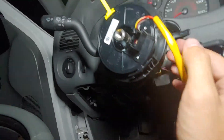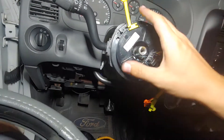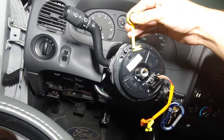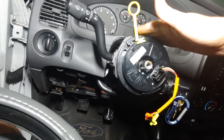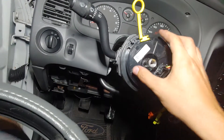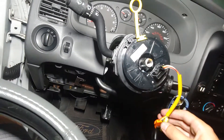Make sure everything is routed properly and that the wheels are straight before you mount the steering wheel. The steering wheel spline should be flat on top and flat on bottom. This pin here represents the top and should be on the top half — the pin is there so the clock spring doesn't rotate before you use it. If it turns all the way to one side and then you turn it even more once the steering wheel is on, you'll rip it.